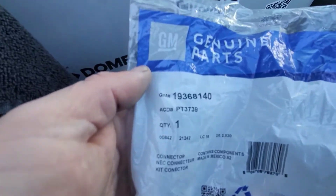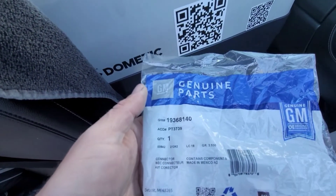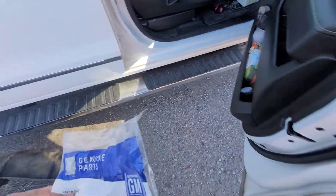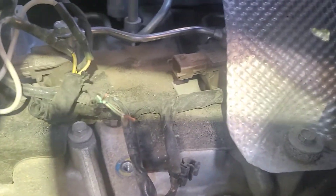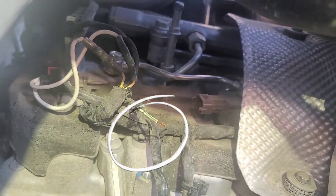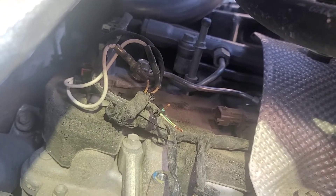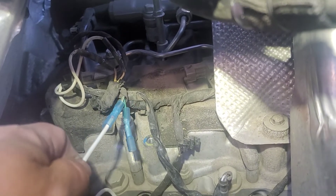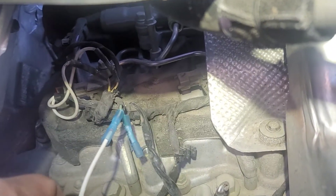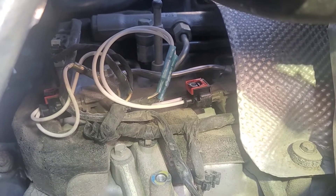I always like to show a picture of the part and the part number, and I'm leaving a link in the description. I've been ordering these off Amazon and I've not had one off Amazon fail yet. Number 7 is from the dealer, number 4 is from Amazon, and now number 5 will be from Amazon. You can see what I've done - unplug the connector, cut the connector off, strip the wires back. Now I will plug in the new connector, see how much wire I need to trim off of the new one. I can't stress enough - when you're putting these on, they're kind of hard to get at, but always do a really good tug test when you get done. The first one didn't crimp good and I pulled on it and it came right loose and I had to redo it. Always pull on it pretty good.